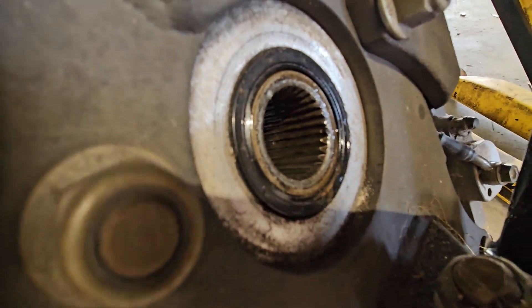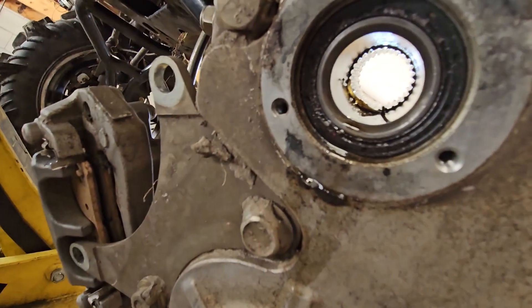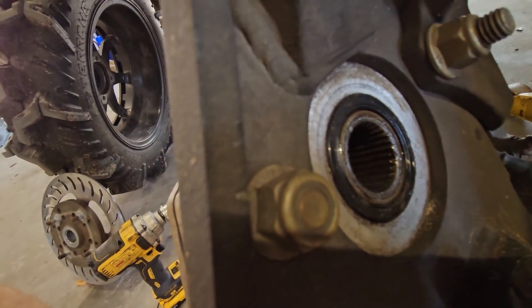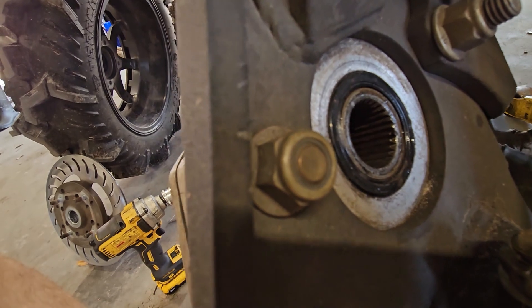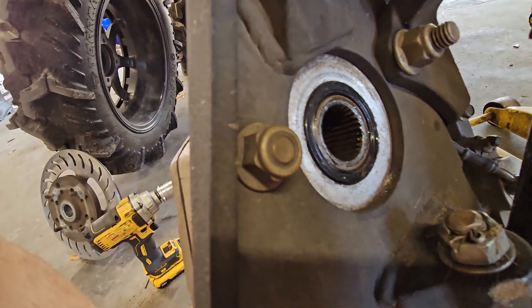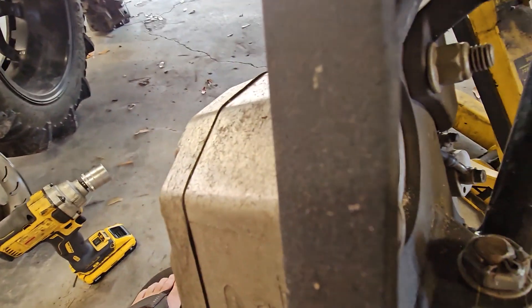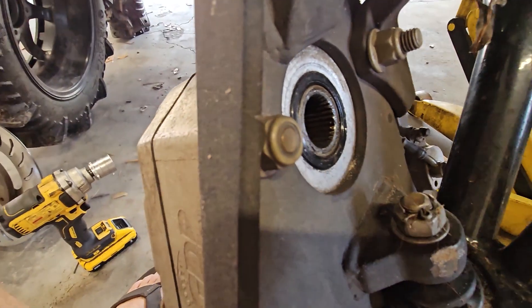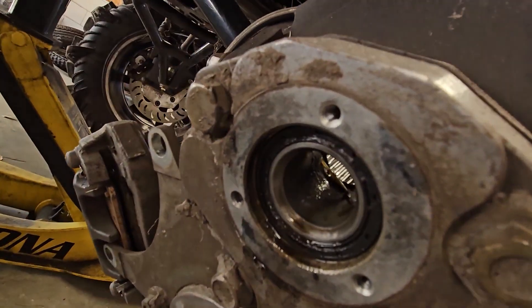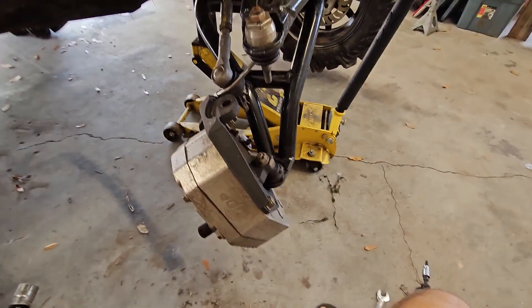Observation: there is some gear oil leaking out of both of these seals — not great, Super ATV. That's probably why my oil is a little milky, but I just changed them. Probably going to change them again for the next ride. It looks like the seal is not sitting quite deep enough in the portal; you can kind of see how the lip is hanging off the edge. Super annoying, so I'm going to get a punch and tap both these seals in a little deeper. Portal problems.